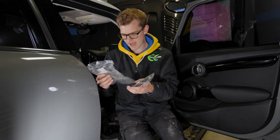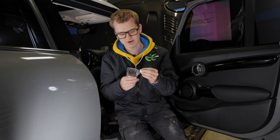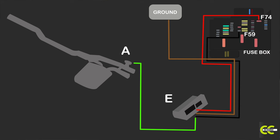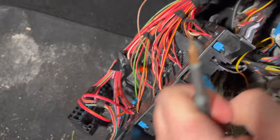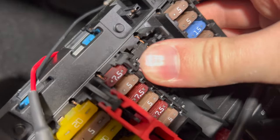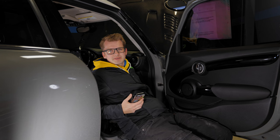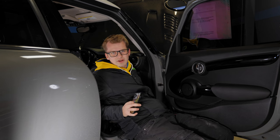Open your bag and inside you have two fuses — one labeled N and the other O. The N1 fuse is for the red cable: go to the fuse box and plug it into slot F74. Then take fuse O and plug it into slot F59. Now we tape these cables, put it back together, and then route the cable down to the canister underneath the car.